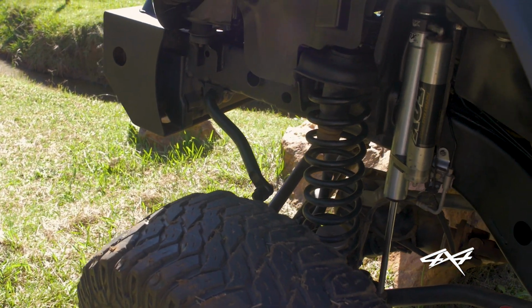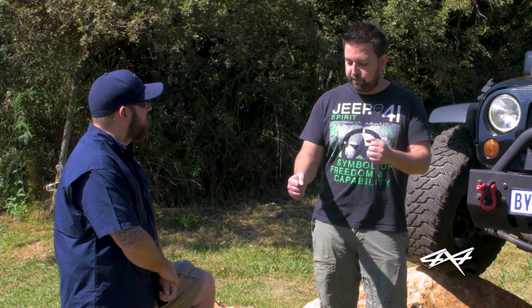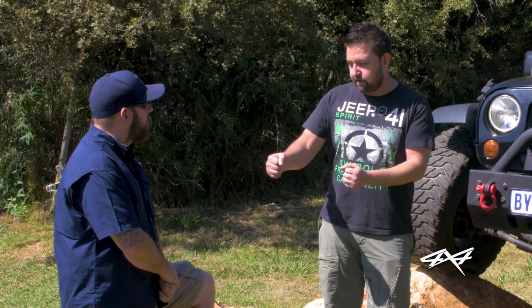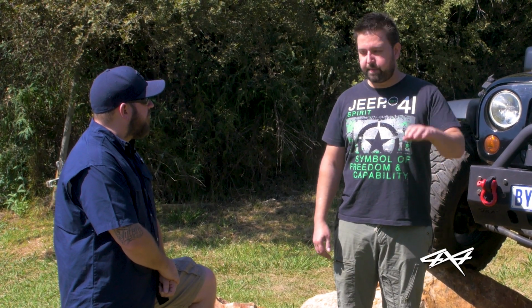3 inches and above. Mine's sitting at a 5-inch now, but my last Jeep, I had a 3-inch lift kit. You can actually feel bump steer. You'll hit a rock on the road, the tire wants to go that way. The tires sort of do this while you're driving. Stability when you brake, it nose dives, when you pull off it squats.